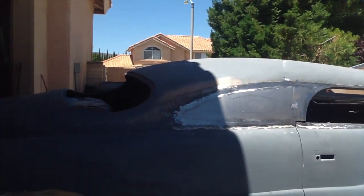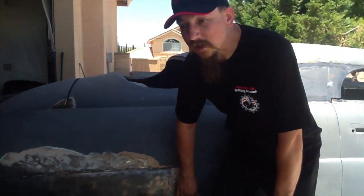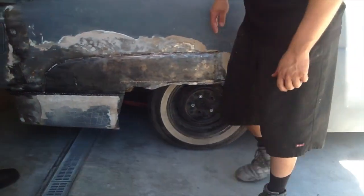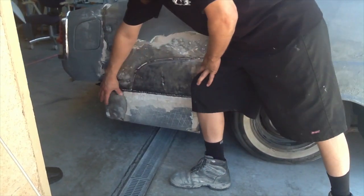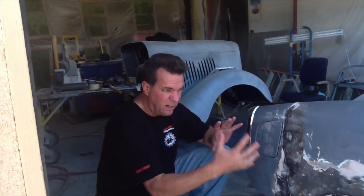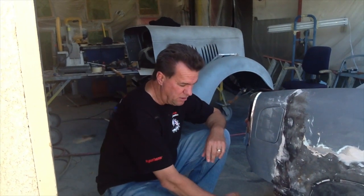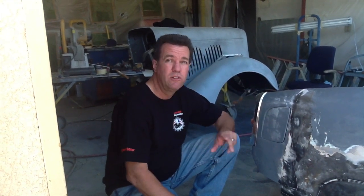This is where the real problem is. Tim, talk about your plan here. The plan is to actually reshape this wheel well opening, get rid of this conduit that somebody put in there, cut this completely off, make a whole new piece going down here, and French in the bumper all the way back. What we're doing is incorporating a 1955 DeSoto rear quarter with the taillights — I chose that because I like the way the taillight looks and extends and lowers the car. When I put the rear DeSoto bumper on, we figured out there's going to be some major sheet metal work, and Tim and Gabriel are excellent at that — they're going to French it right in and make it look like it was supposed to be on this car.